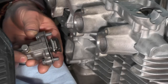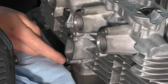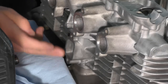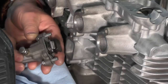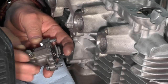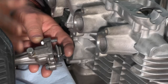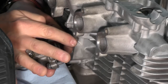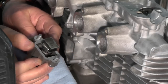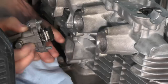So now I'm prepared to install the tensioner to the back of the block. I've cleaned this surface really well, and you can see the tensioner — when you push on that plate — activates the chain. This has been cleaned thoroughly several times. I retracted the plunger and tightened this set bolt down. I want the plunger pulled back until I complete the cam work, so I don't want this extended all the way. The gasket's been installed with a light coating of anti-seize on both sides, and the fasteners have anti-seize on them as well.